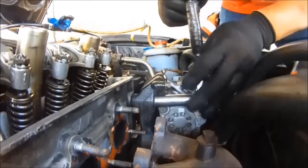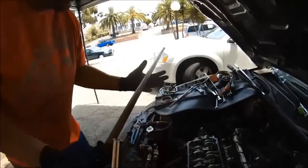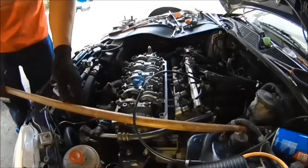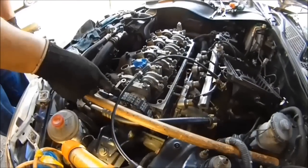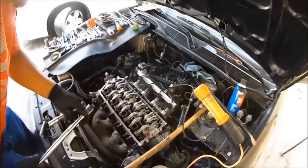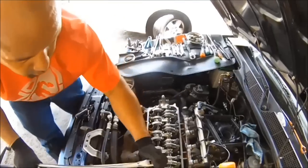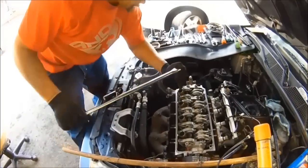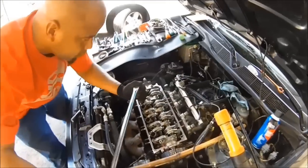Just this top bolt on the power steering bracket. Next is the stick — this is where it comes in. We're going to put the stick right here, slip it in, take off the camshaft sprocket, and suspend it in the air. Next it's time to break loose the cylinder head bolts. Get your breaker bar, 14 millimeter six-point socket, criss-cross pattern.